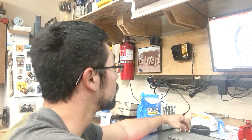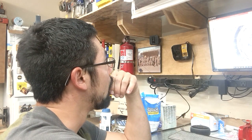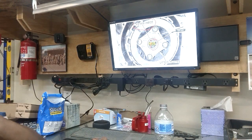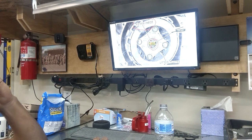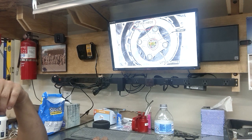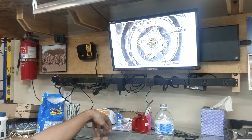A couple of tips here. In the center there is a lifter piece which has grooves, and one tip is when you're putting it back together, you'll be fooled — it doesn't want to seat all the way into the center of the clutch lifter plate. The manual says if it doesn't seat, re-loosen these bolts and then twist and push to make it seat, which is what I did, and ultimately it did seat. You'll think it's seated all the way, but it must be all the way down into the lifter plate. Don't mess that up — that's a big deal.